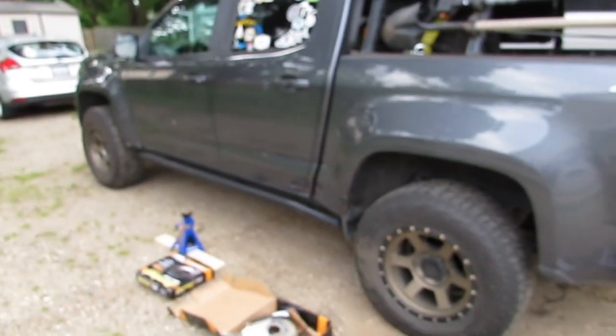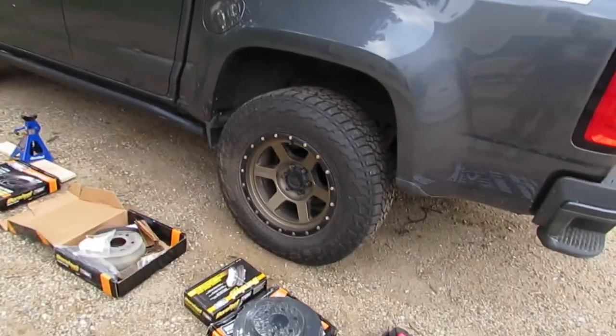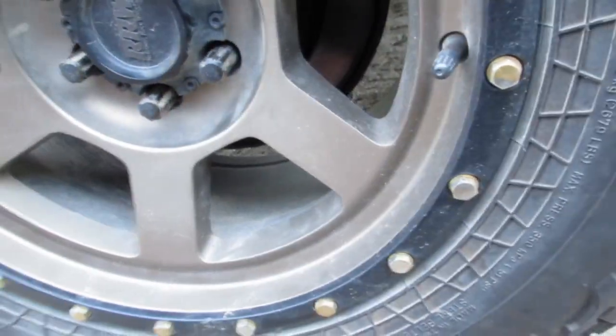All right, so I drove around the block. Everything looked okay. It felt really nice to have good working brakes that don't squeak every time you press the brakes. I did go ahead and retorque everything. One thing you can check to make sure it was working okay is the actual rotors, and there should be some obvious wear. For me, mine were all black, and all that black faded off. You can check that on both sides. That looks good. In my case it does, so I can assume they are working just great.